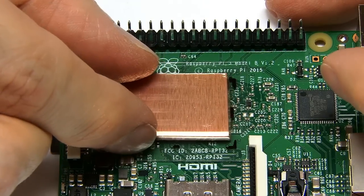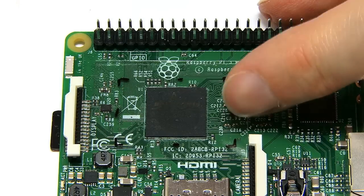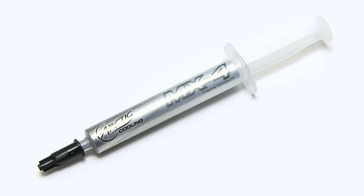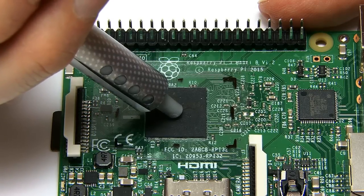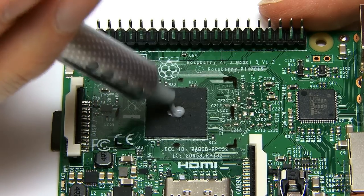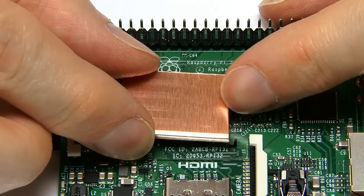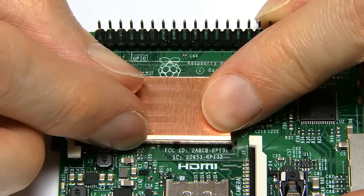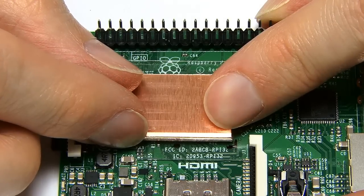I've cut the copper bigger to get the maximum amount of metal, and I've put marks on the plastic so I can work out where to drop it on. I'm now going to take some Arctic MX-4, a nice little bit of thermal compound, and put a tiny bit on top of the Pi's processor. That's probably a bit too much actually, but we'll go with that and let it spread itself round underneath. That should smooth out very, very well — I can feel it going around nicely. And there we are — we have our piece of copper placed on top of the Pi.